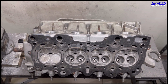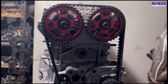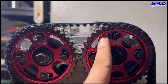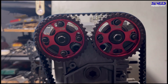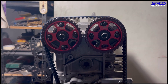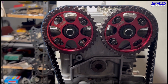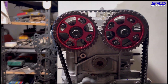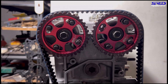Now we've cleaned up the sides and reshaped the chamber — it's all good. We cleaned it and put it back on the block on the engine stand. The head is back on with the cams, all preset. On the intake it's advanced three degrees and the exhaust is at plus seven, so we have a safety window to check with the clay. Sorry for the shaking — I'm trying to turn the engine with one hand while the other is holding the phone. The long power handle makes it possible to turn with one hand.